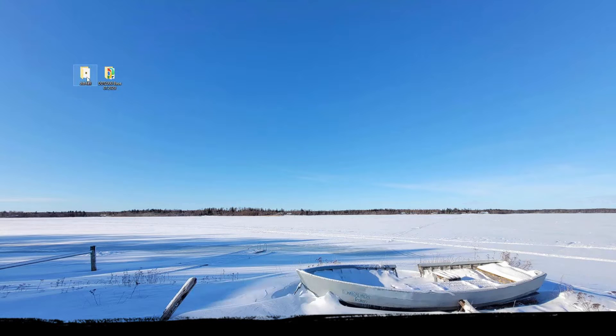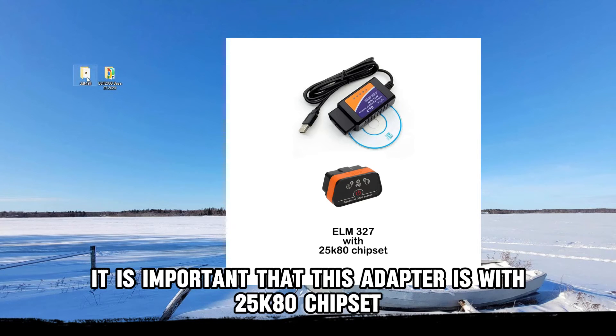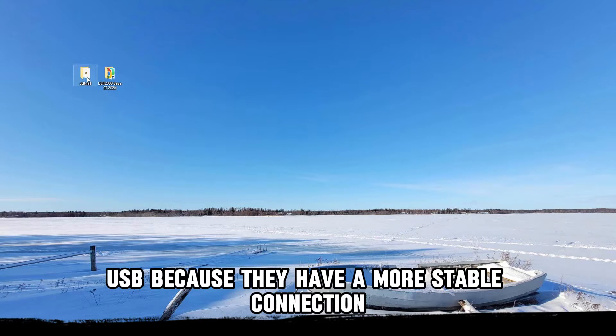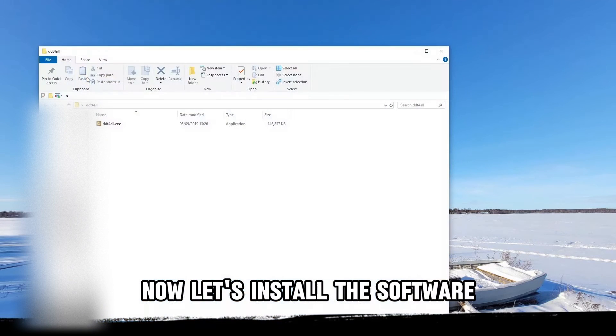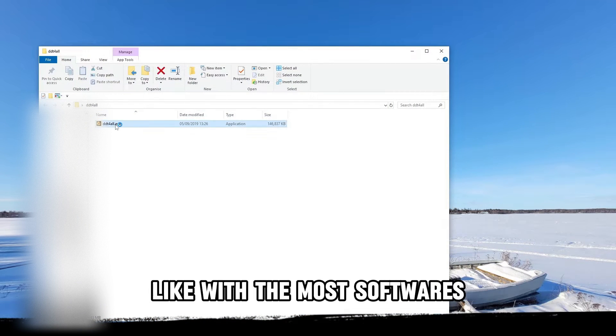The database files are usually on some torrent site as they are quite large. From hardware, you will need a laptop and an ELM327 OBD adapter — it is important that this adapter has the 25K80 chipset. I have a Bluetooth V-Gate OBD2 adapter which works perfectly, though some people prefer USB because it provides a more stable connection, making it less likely that the connection will be interrupted during coding, which can irreversibly damage your car's ECU.